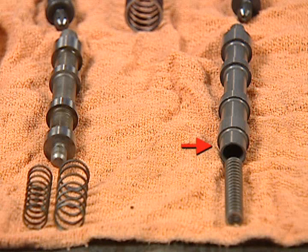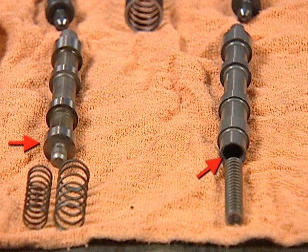The new design TCC valve uses a single spring and is shown with the previous design level valve with dual springs in figure five. The new valve uses a spring pocket to prevent misassembly by only allowing the spring to fit into the pocket end of the valve.